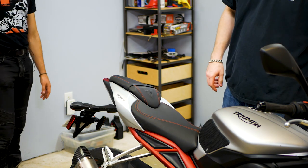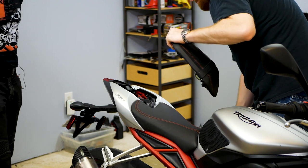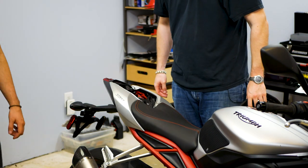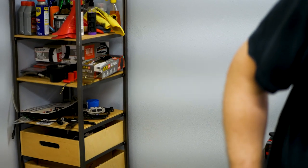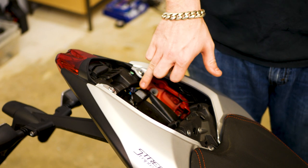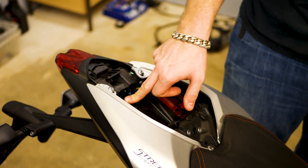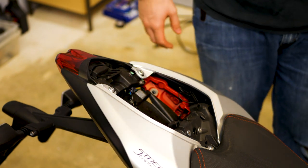First thing's got to come off. This looks pretty simple — just a couple of four bolts right here cut out from the frame. We'll have to pull out some of these wires to get at our indicators, because we are preserving the stock indicators. They're all right here, so we'll pull that screw out, this will come out, and then we'll just unplug and go.